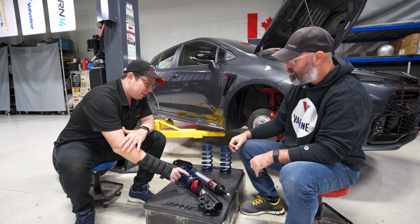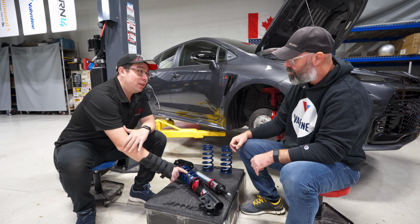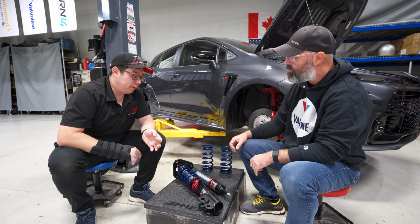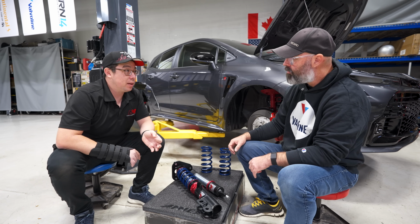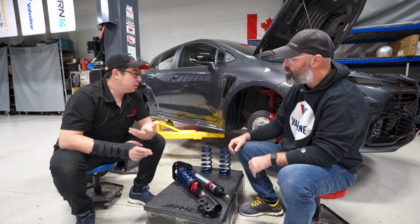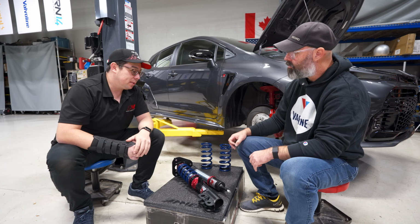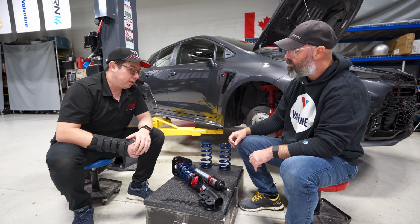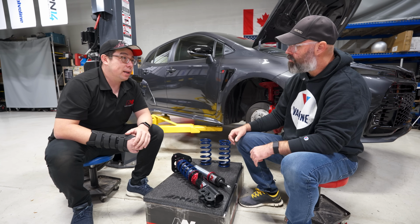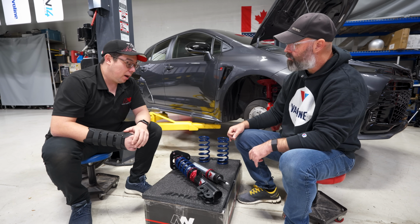Since this tube has to fit in what was the old tube, inherently this is a smaller shock, right? So there is a smaller piston inside. In our case, this is a double digressive piston. We're still experimenting with that, and hopefully at the end of this test, you guys like it. But there can be some ride and handling trade-offs with double digressive. At any rate, it's a smaller piston, so we did have to carefully pick the valving and take a look at the high speed flow rates on the dyno and stuff like that. So experimental, but we really love optimizing shock.